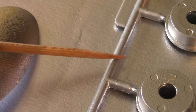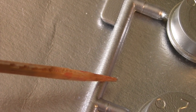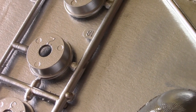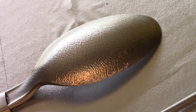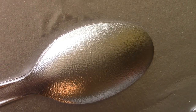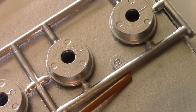Now with New Finish or the Scratch Doctor, that would normally absolutely destroy it, but it didn't. It didn't have good results, but it also didn't turn it dark gray or take the cover off because it's so rock hard. So that told me that we have a different situation here. This paint kind of creates a shell that is metal, and that would be aluminum. So what it's done is it has created an actual aluminum plating, albeit a rough one, but a very, very hard plating with nothing else.